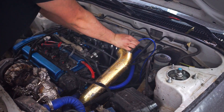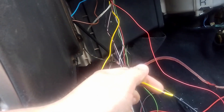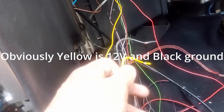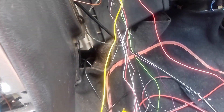Now on to the wiring, which is maybe a little more complicated but also no rocket science. I have the controller mounted behind my glove box and the wires just run through there, because I have a pass-through to the engine bay right there where my ECU is also located. As for wiring, it's pretty simple. As you can tell from the wire gauge, the yellow and black wires are for powering the whole thing — they're a bit thicker and you need to run those to the battery. They don't need an ignition switch; they are just 12 volts at all times. Yellow is for power and black is ground on your battery.